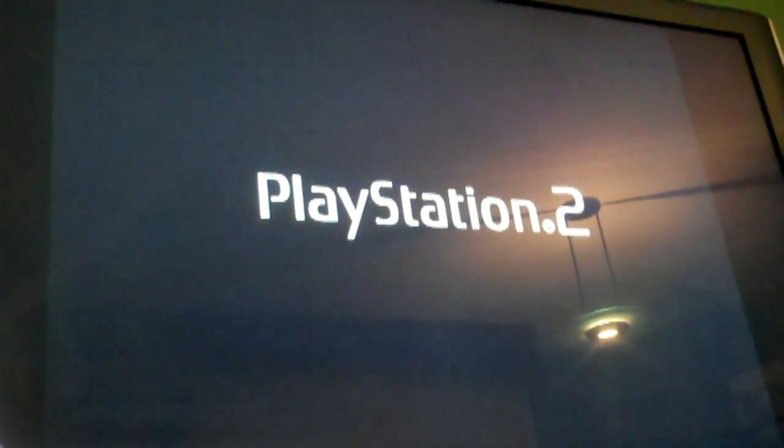People probably don't know this. The PS2 has 2 lasers, even though you only saw one. There's one beneath that, and it looks like it's reading the game. A PS2 can be capable of reading one of these CD games with no problem and still not be able to read DVD games. So it looks like it's working. It's at least reading CD games, but that is more common, and it may still not be able to read the DVD games.